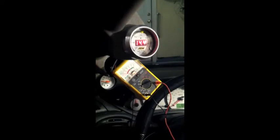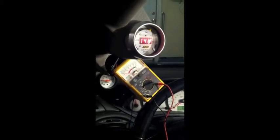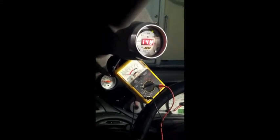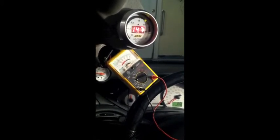This is the video of me testing the voltage coming out of the wideband through my firewire cable that goes into the livewire tuning, livewire tuner, into LiveLink 6.5 on the computer. I'm just doing this to show that I am receiving voltage from analog 1 and it is relative to what the wideband is showing. I stick it in the pin right here where it's supposed to be in analog 1. I have the whole cable — the main ground is grounded, and the analog 1 ground wire is also grounded by itself.